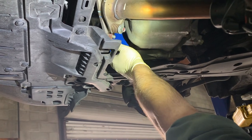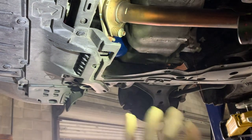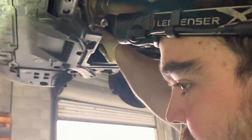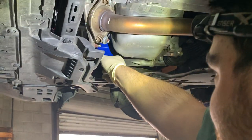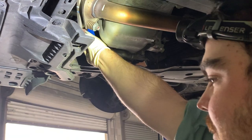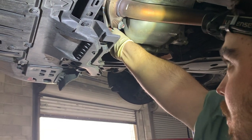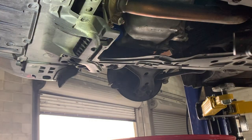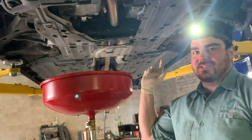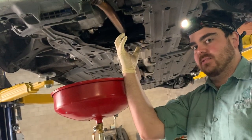Just make sure the oil filter screws on smoothly — you should not have to force it. For tightening, ideally you'd use a torque tool, but not many people have that. It's really a feel thing. I've been doing this for over 10 years so it's just feel — you want it snug but not as hard as your arm can take it. I know which muscles to use to tighten an oil filter; if I used my whole arm it would wrench it too tight.